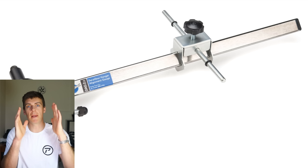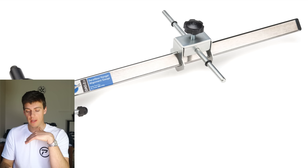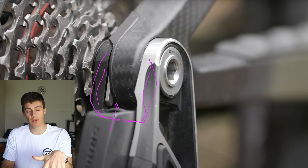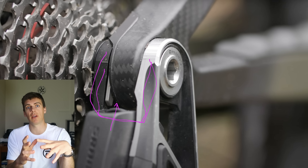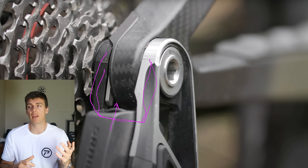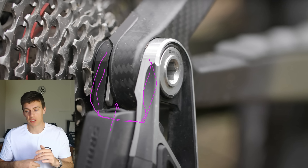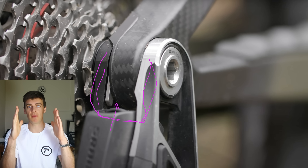With the new type, we can't do that. There is no adjustment on this mech for angular or parallelism errors. You are set entirely by the carbon frame's rear triangle — or aluminium frame, whatever it is. We know that when you heat-treat a TIG-welded aluminium frame it does go out of alignment, so that shifts even more QC pressure onto the factory to make sure everything is aligned.